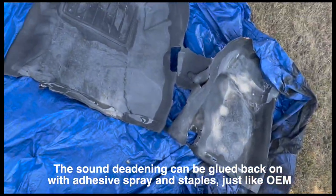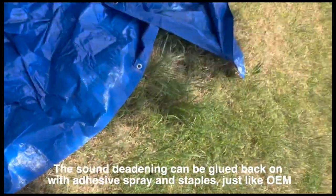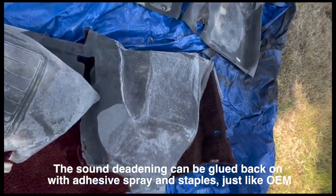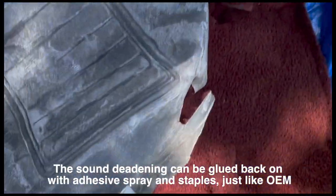Using the RIT dye can end up being a huge pain. You're going to need about six to eight bottles of RIT dye, a huge bucket, an area where you don't mind spilling dye, a way to bring lots of very hot water to the bucket, and a few days to a week for it to soak — the longer it soaks, the better. I suggest removing the sound deadening from the carpet to save space in the tub, and always clean the carpet as best you can first. I had to drive about an hour to my buddy's house to do this in his backyard.